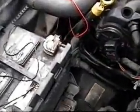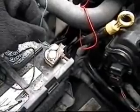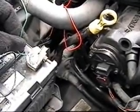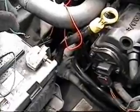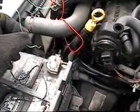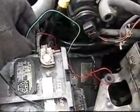I've got the cooling fan connected directly to the battery to see if the fan motor works. This must be the low side — and that side is working. Now I'm going to connect to the high side and test it. I've got it connected to the high side and there's no power to the high side.